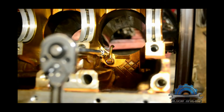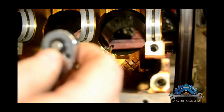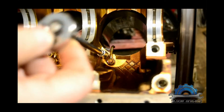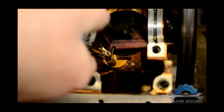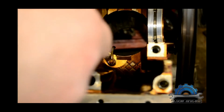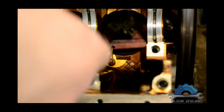But before you do that, you want to remove the spraying nozzle which sprays oil under your piston to cool it down and lubricate. You can't hone with this in place — you might damage it or bend it — so one minute to remove that.